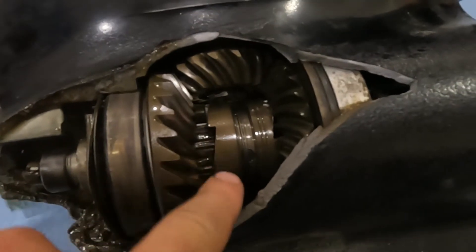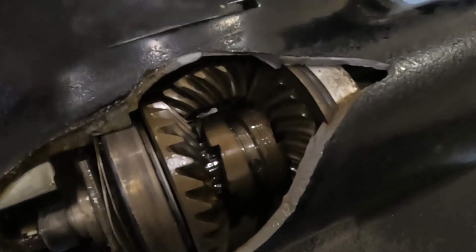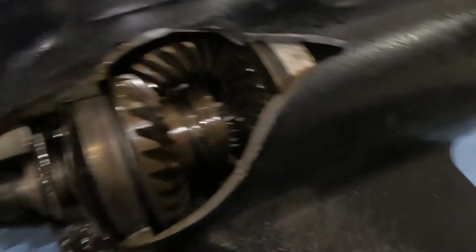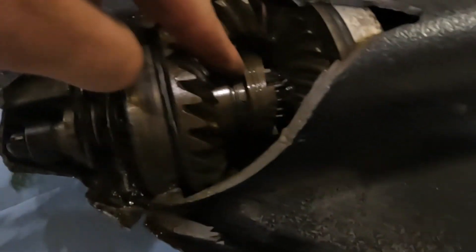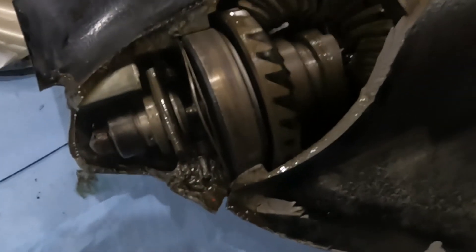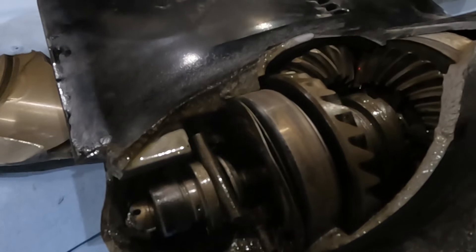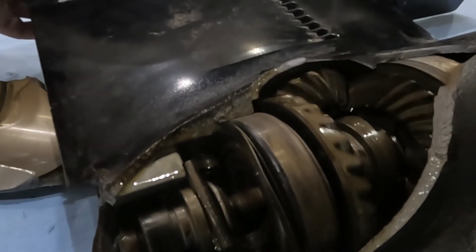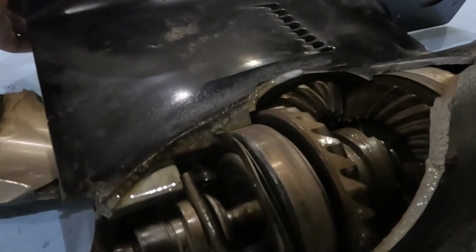It just shifts between the two gear sets — those gears have dog teeth and the selector has the mating dogs on it. So you click forward and reverse and it selects. This continuously drives and then just decides which gear engages to determine which way the output shaft turns. That's kind of neat. None of the gears look that bad to be honest — none of them are busted. It's just the metal case.